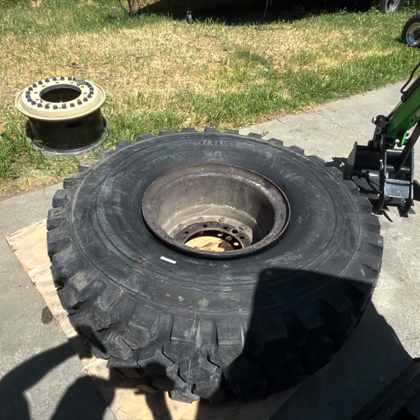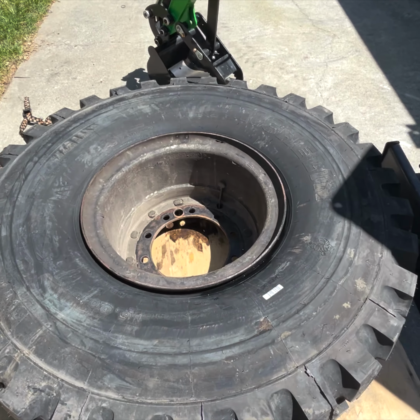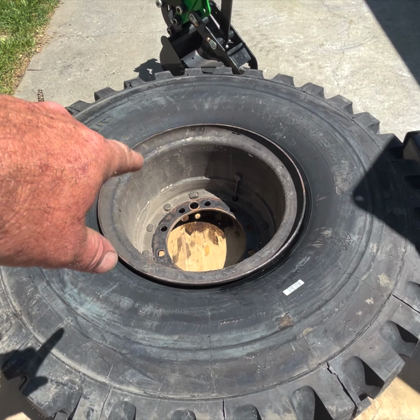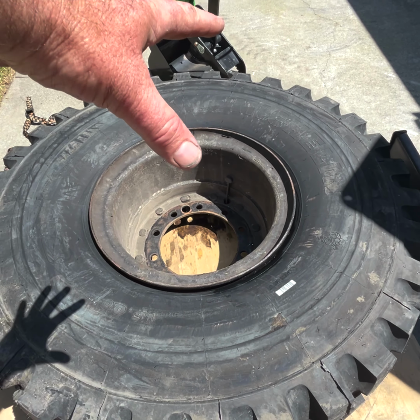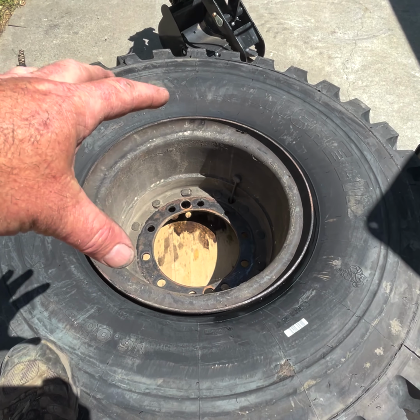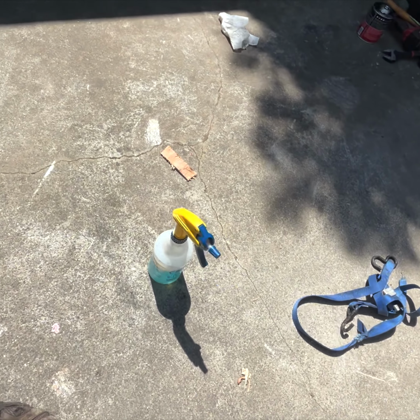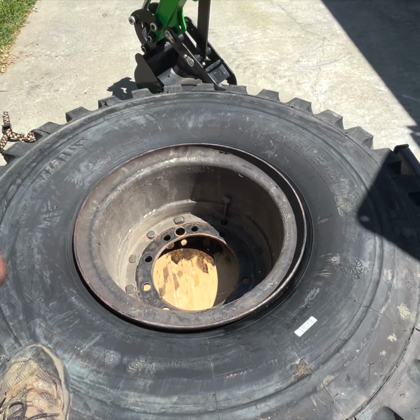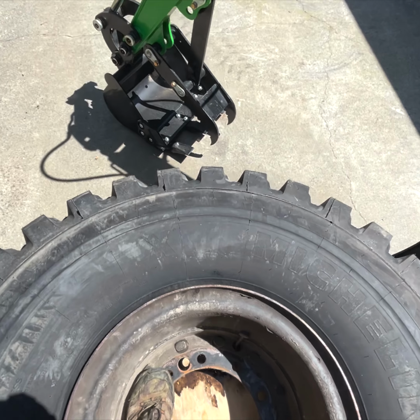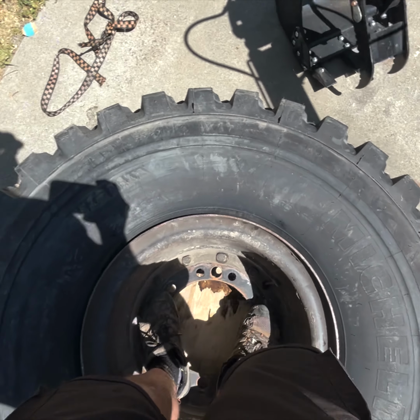So I put the O-ring in the wheel, which I don't have a wheel apart to show you now, but the O-ring was in there. Just loosely put the nuts on so I wouldn't screw the threads up. Basically had the internal bead lock centered. I hit everything with some soapy spray water, just some Dawn in a spray bottle. Got it nice and soapy. Threw the rim on top, and then I just stood on it like this. Bounced a few times, and the thing slid right in.